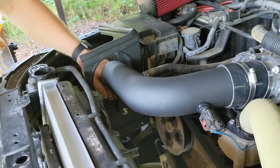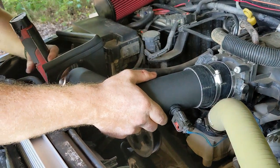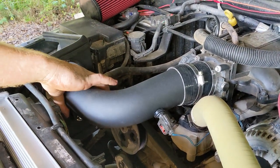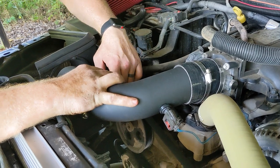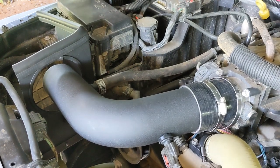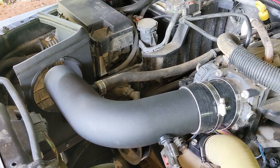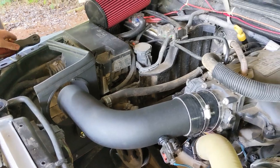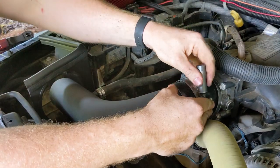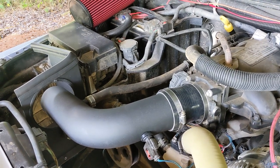So that's in. It would actually be a lot easier replacing the stock one, because you just put the box and the tube back for the stock and don't have to replace that sensor. Put that hose back on exactly the same, sensor clips in exactly the same. So it's really just a different box and filter. Also available at ExtremeTerrain. This is the Red Rock cold air intake kit we're installing. All these are 8mm clamps, so tools are pretty on par with what comes from the factory.